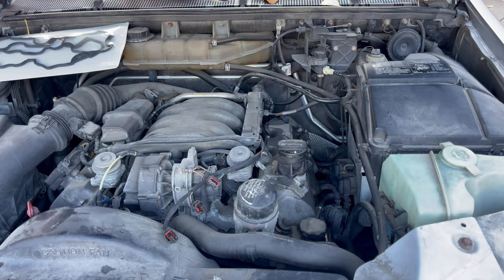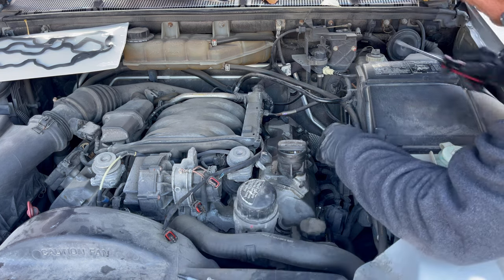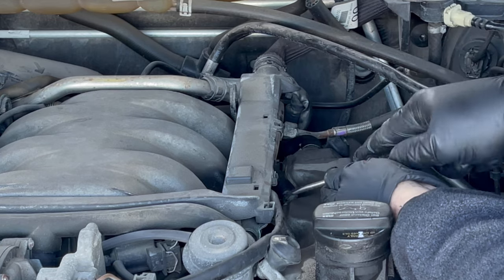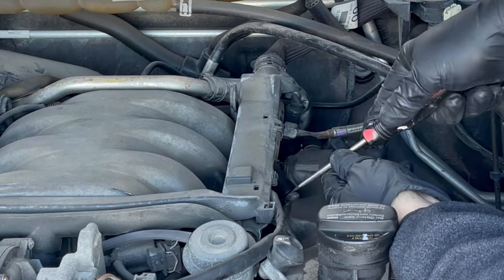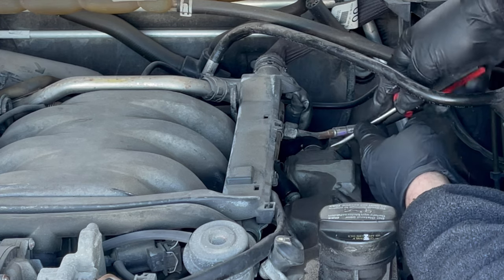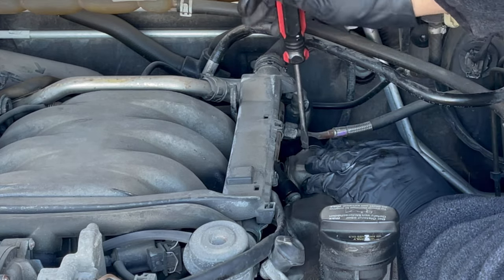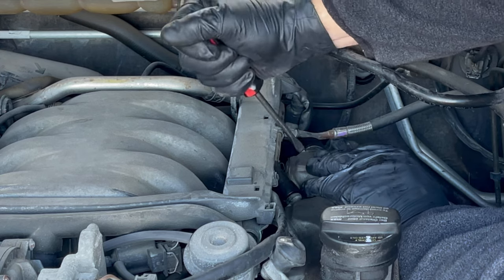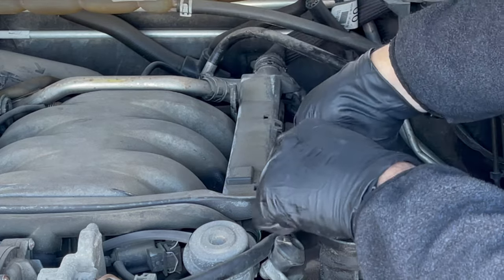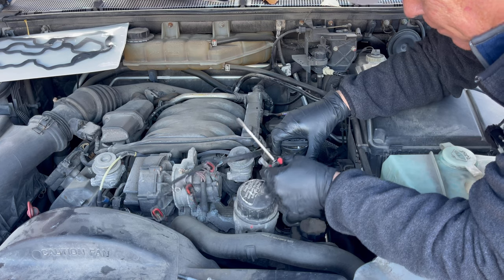This is the moment of truth. Well, this is where we take the valve cover gasket off. So I have all of these little Torx bolts out, okay? I have kind of lubricated where these very plasticky, rubbery little bits actually go. And I don't want to break them. I really don't. So hopefully what I have done will prevent this. I sprayed them liberally with silicone, WD-40, all kinds of good stuff. No, I just use silicone. This one I think may survive. Let's just see what happens.